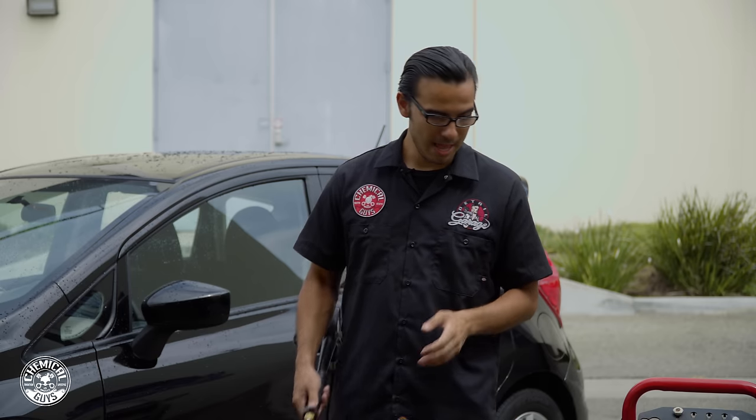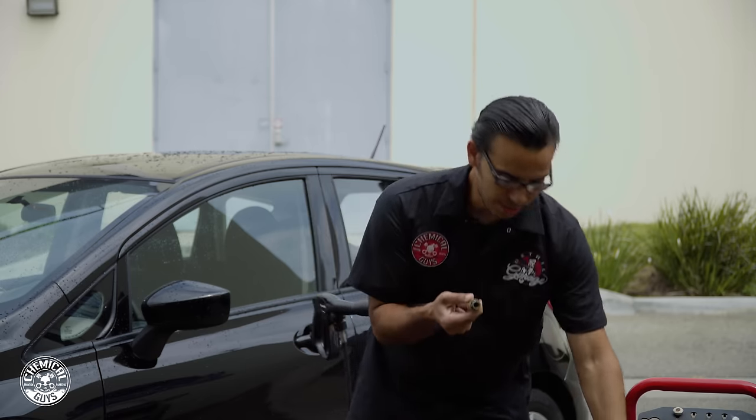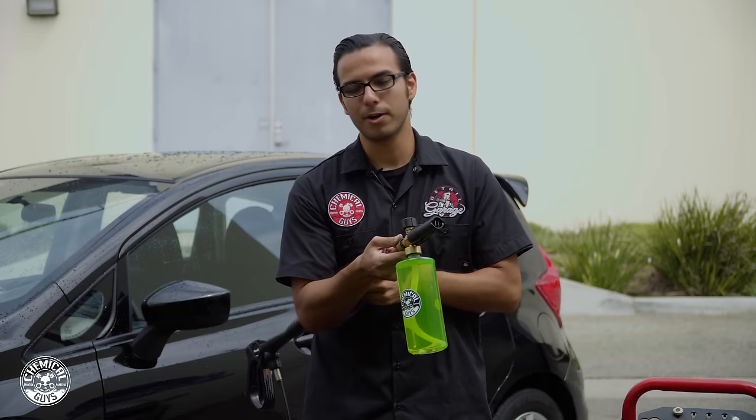They're already clean because we did that off camera. There's tons of videos on our channel showing you how to clean wheels, so we're skipping right ahead to the wash process. Now we're going to go ahead and set up our foam cannon by attaching it to our wand here. Just pull back on this quarter inch sleeve and it slides directly onto the foam cannon, snaps into place, and you're ready to go.